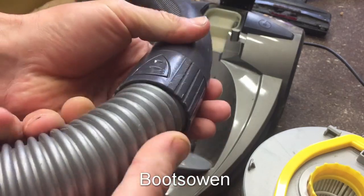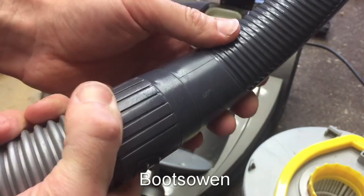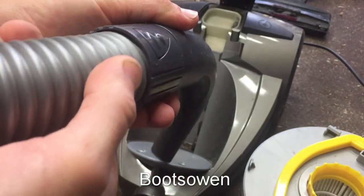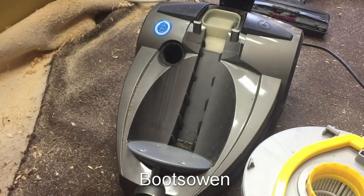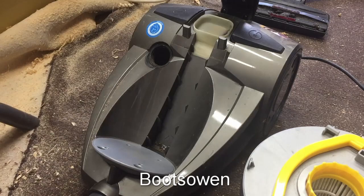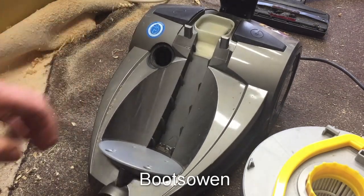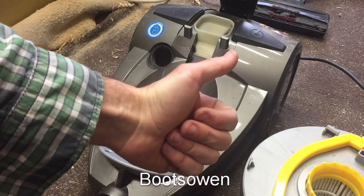It's the curved end that you get stuck on. So if you can find out where the blockage is, sometimes it's possible using these tabs here on the side — this will come apart, but it can be a bit of a labor to figure it out, and most models are different, so you've just got to spend a bit of time tinkering with it. Instead of just tossing out your vacuum cleaner because it's got a tiny crack in the plastic and won't suck, because you're too ignorant to pick a pen up off the floor and a sock — well, there you go, problem solved. Thanks for watching, see you later.